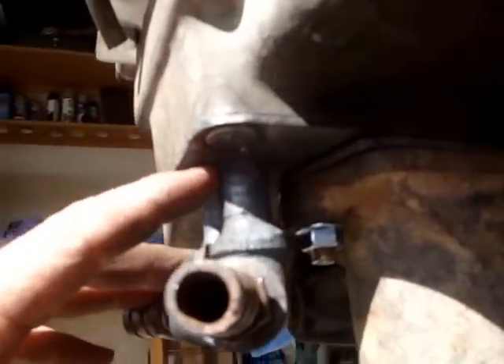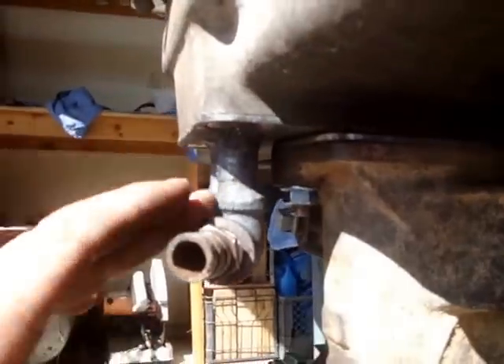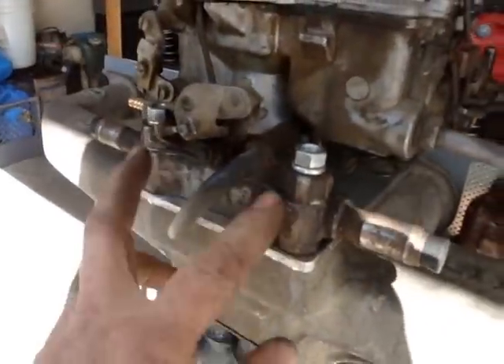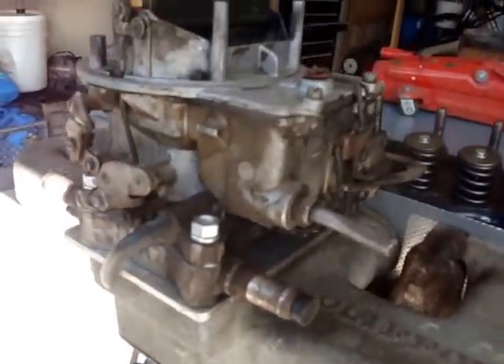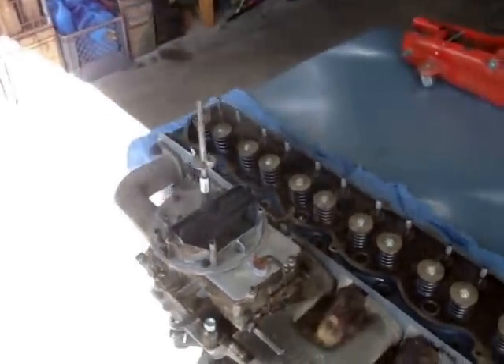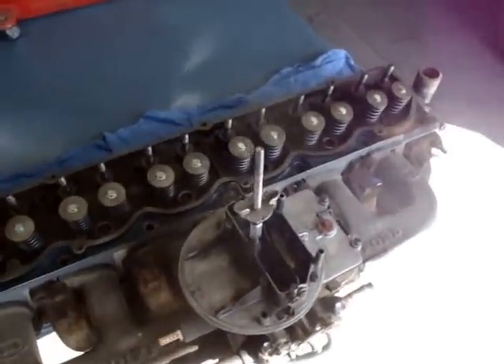I welded my own plumbing in for the heat in and out. I've got a little spacer right here underneath the 2-barrel, just in case I want to plumb heating into it later in case it gets real cold and there's carb icing, but we don't really have that problem here. And that's carburetor and intake.